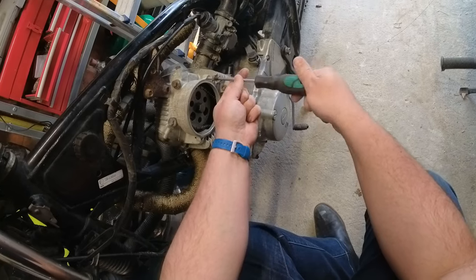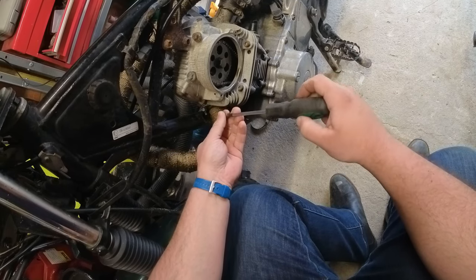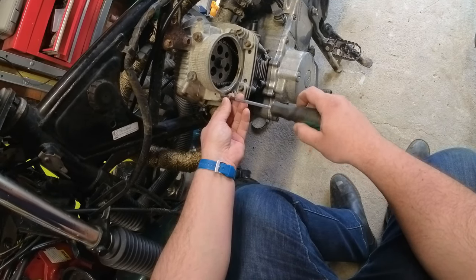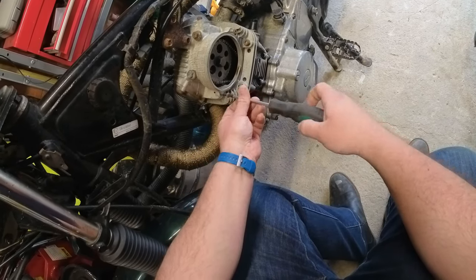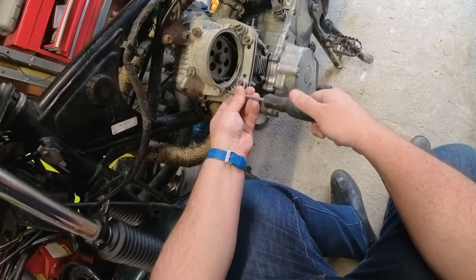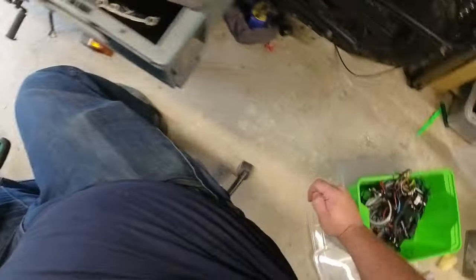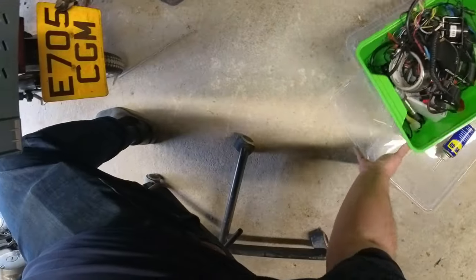You're just watching me remove the timing cover now from the top of the engine - it's just a pair of screws. Worth bearing in mind I still don't know if this bike has JIS or Phillips heads, but this trusty green screwdriver of mine seems to work well for both. The trick really is to put plenty of pressure into the screw head so that it can't cam out.